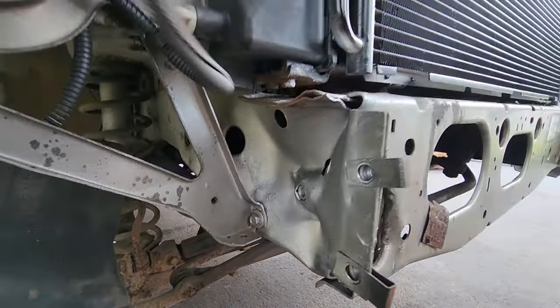And what I do is put this in these little holes right there. I'll hit it with some brake clean, get any oils or residue off, and then it gets a coat of black paint, and that's it. Easy restoration process. Sometimes I'll start out with the industrial purple degreaser. I'll knock off any grease. Sometimes I'll throw it in the Evapo-Rust, get some rust off that way. Other times I will just throw it in this thing and set it and forget it. And oh look, found a socket. All this beautiful clean hardware. So this will go back on the Jeep when the time comes.